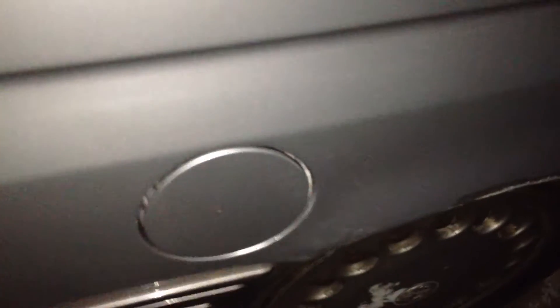So, charging. There's my extension cord. There's the charging cap — press the button and that pops open, and I plug right into that. Now, if for some reason you do manage to kill your auxiliary battery, you will not be able to open that cap. But there's a secret little string here provided by the original manufacturer of the car — pull that and it also pops the cap open.